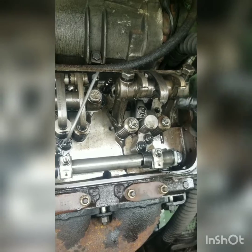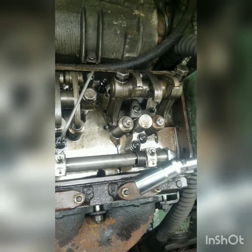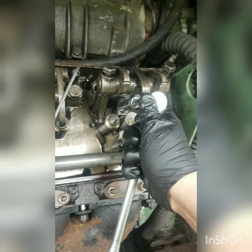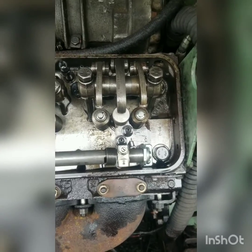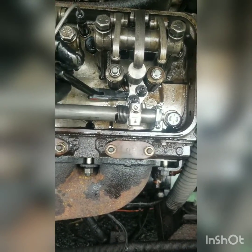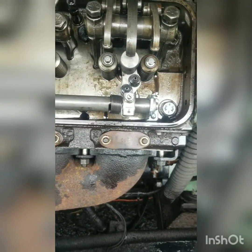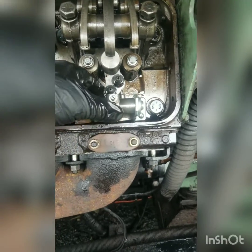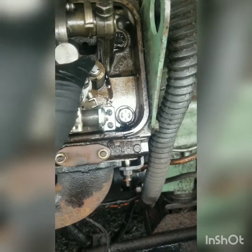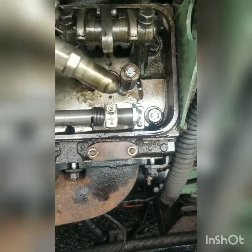So we got the rockers off. They're held up — I just got them sitting against the valve springs here. Use a 9/16 inch socket on a wobble extension and go ahead and pop that injector hold-down bolt out. Once the injector hold down is out, take an indexable pry bar or some type of pry bar, get under it and pop it up. They're a little hard to do one-handed. Once you get that off, you can twist the injector to the side to get it off the rack, and then pull it right out.